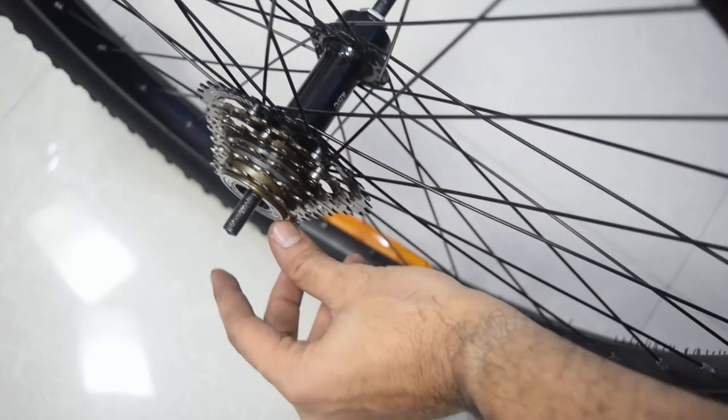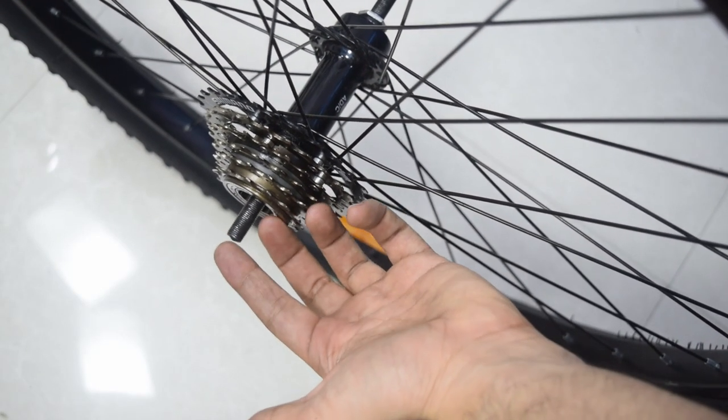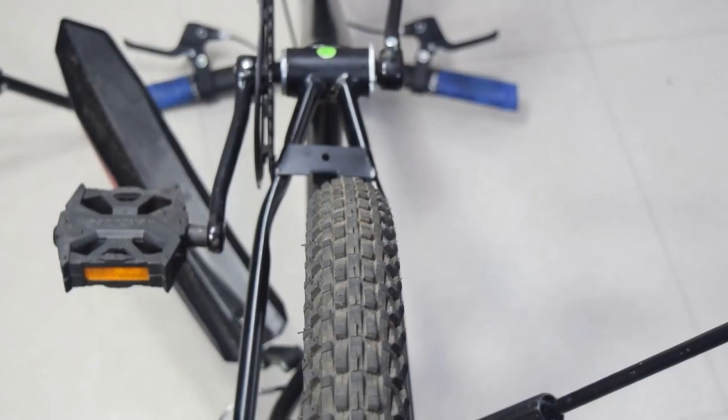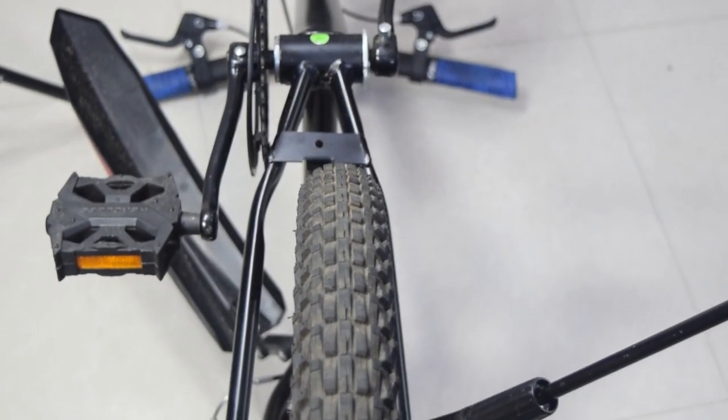The next morning, I tried to put the wheel back into the frame, and I realized that I had two more big problems. The first thing was the axle was not long enough on the freewheel side. Especially once you accounted the thickness of the derailleur, there was barely any space to put on the axle nut, and this was not going to work. The second problem was that the wheel was no more centered in the bicycle frame.